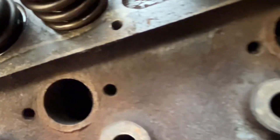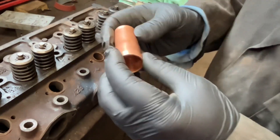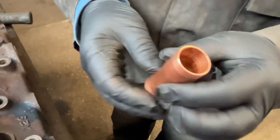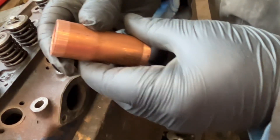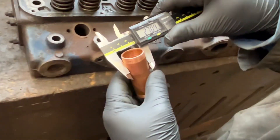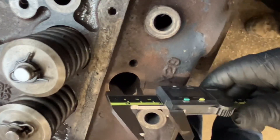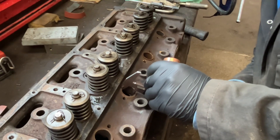The original part 86K1098 is just a copper sleeve. It's swaged — it's not a machined item. What you'll notice is that the head here is slightly larger than the ball. So that's 27.4mm, and the ball in the head is about 26.6mm or thereabout.